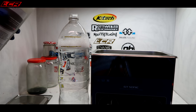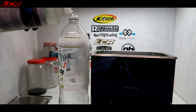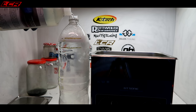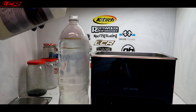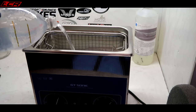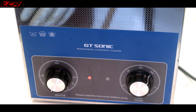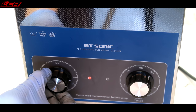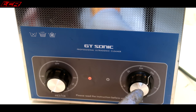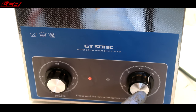I've marked it - it's all very technical. That much water - I know if I pour up to the second gold line I've got my 10 to one. A little shake and then we pour it in. I'll turn it on to 60 degrees - it's got a little heater in it, so it'll warm the water to 60 degrees. I used hot water but it's only 20 at the moment. We go to 60, that'll take a while. It's also got a timer - about 15 minutes apparently to clean something like a set of throttle bodies.